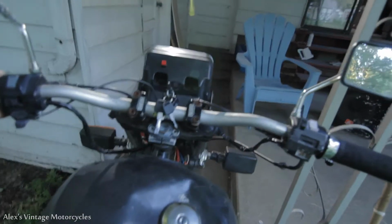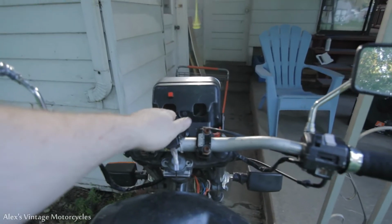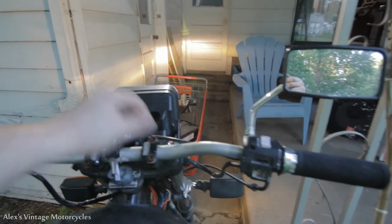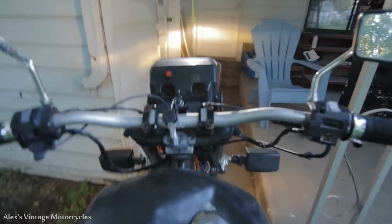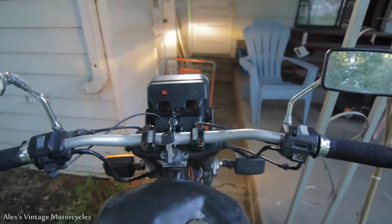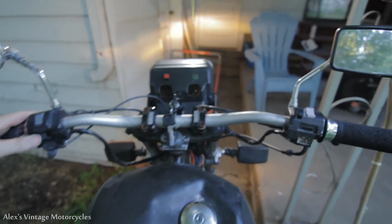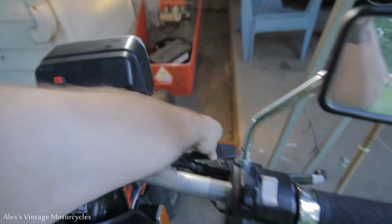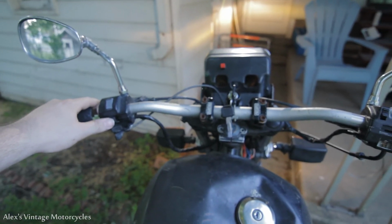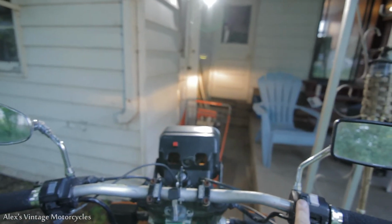Make sure we're not in gear, because we bypass the neutral switch, the clutch switch, all that stuff, which always messes up on these bikes and leaves you stranded. But headlight, kill switch is on, down. Hit our nice little start button. So now the turn signals want to work. Turn signals are giving me some trouble. It's the contacts in this little switch here need cleaned. You probably just saw that left one was flashing. High low works. We got our switch for our little yellow auxiliary light.